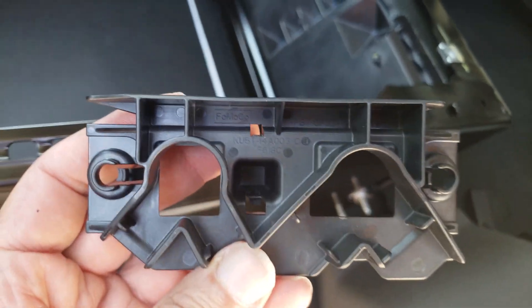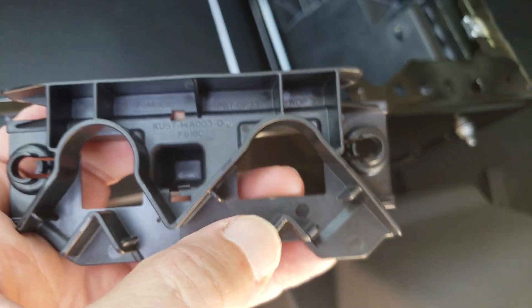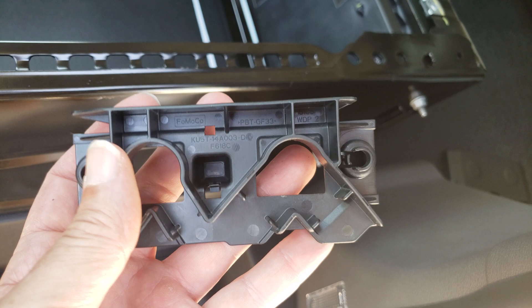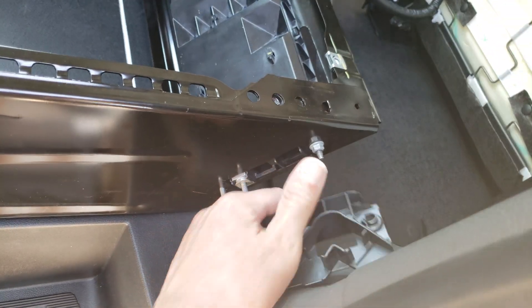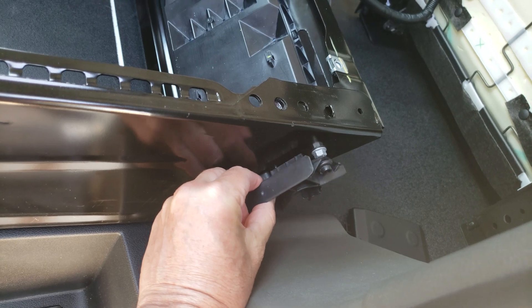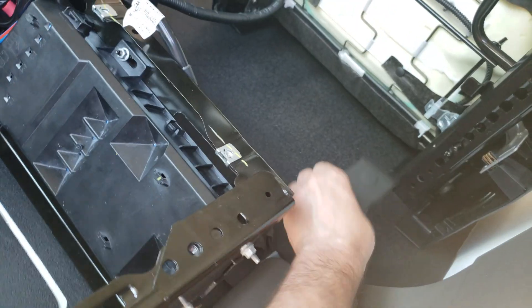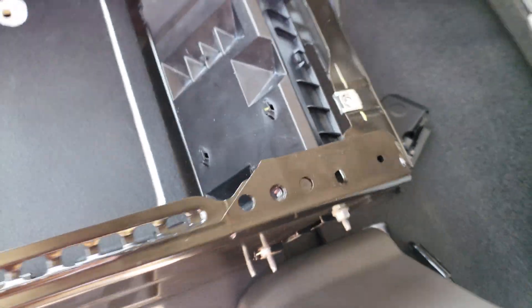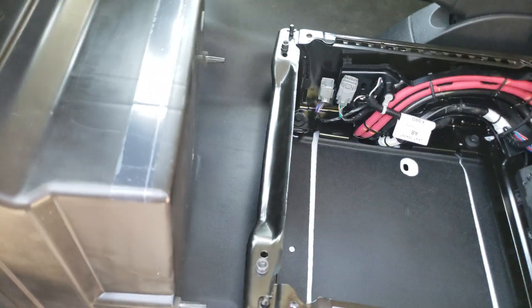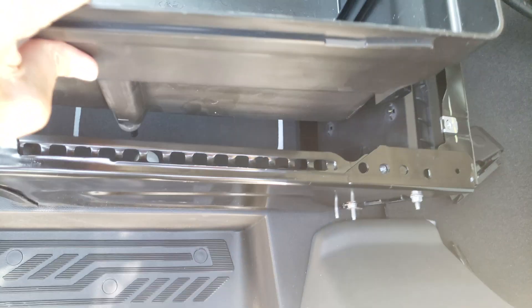The customer connection point has a cover — there's an insulator plate that's cut out for different wire gauges. This is the 60 amp path and this is the 175 amp, or whatever the higher one is. Since this vehicle only came with one battery, it doesn't have any of that other stuff in here, but this just snaps right in place. It has a cover that covers that part when put in place, and that can be removed so it's all safe. I'll get back to what I was talking about — I'm going to put the battery box in, just have to align the two pins I showed earlier.